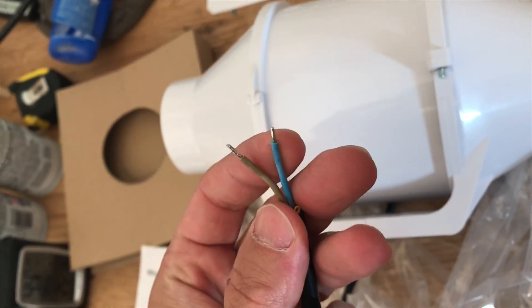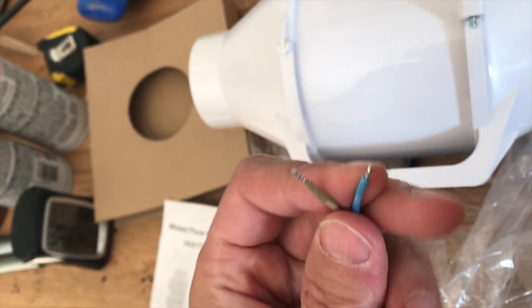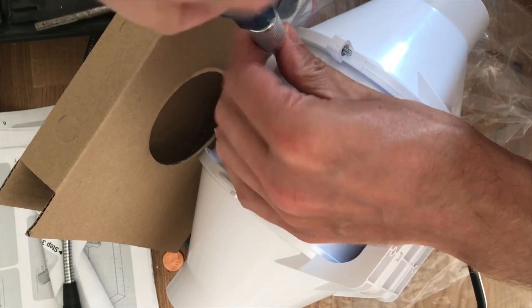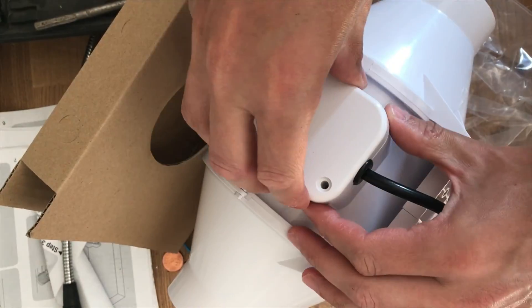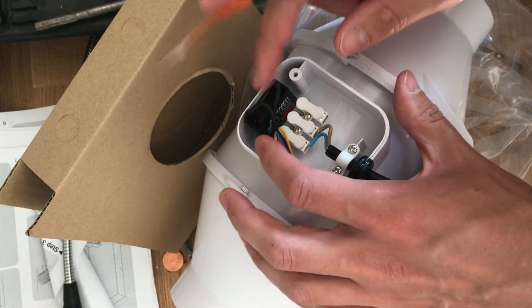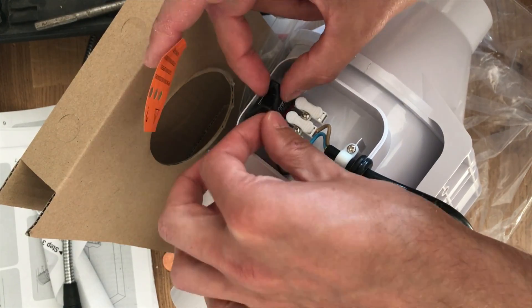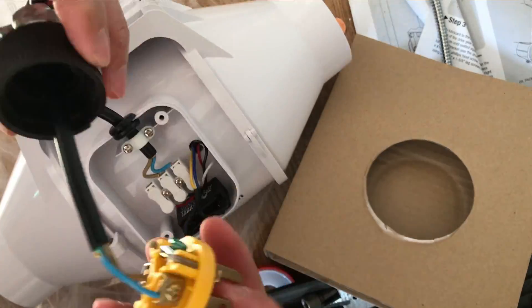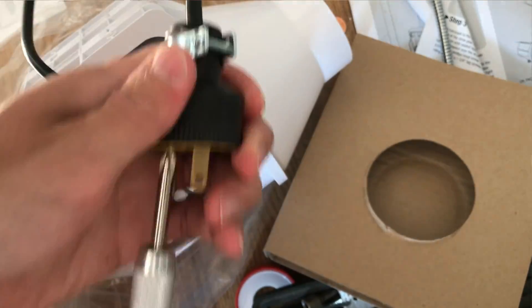The wires are a little thinner than what I hoped for and I do need to extend that ground wire to make it usable. Opening up the little electrical panel, interestingly — though not surprisingly — the ground wire isn't connected to anything, so this fan isn't grounded. We'll carry on and install a plug onto these wires.